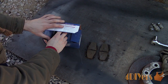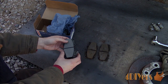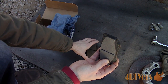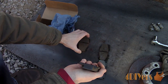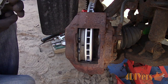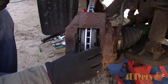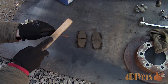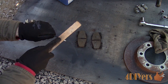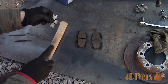The inner and outer pads are the same — it's a good idea to compare the old and new pads to ensure they are the same. The little metal tab on one side of the pad is a wear indicator dictating when the pads require replacement. When this touches the rotor it will make a squealing sound. While the old pads do have a fair amount of material on them, this truck is getting ready for the road so I want to make sure everything is up to date. Make sure the pin holes are facing out and the small radius cuts in the backing plate are facing towards the hub side. The pad should slide easily into place with no binding. The retaining pins should also be cleaned up using a wire brush — there is no need for any lubricant, as dirt can stick to the pins and risk having grease drip on the braking surface. The spring clip should be cleaned up and inspected for any damage such as cracks; replace if necessary.